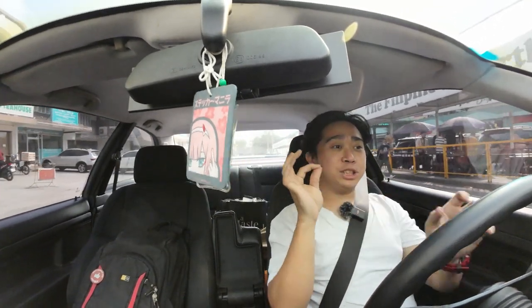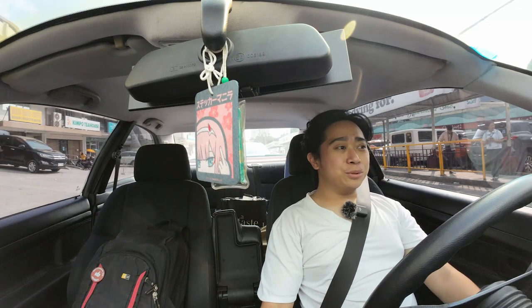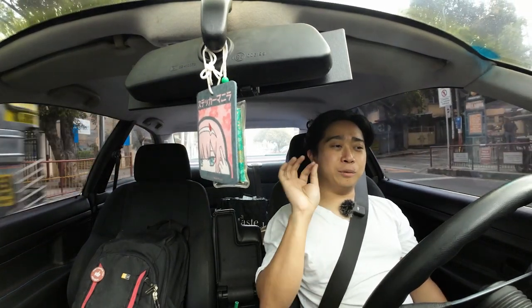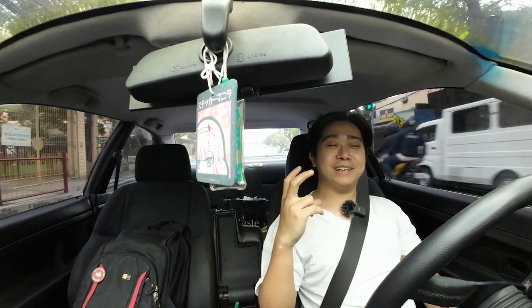Going back: with just the spring preload mod alone there's been a significant reduction in pedal effort. I tried it without the preload shim and the clutch felt lighter, and now with the preload shim it's even lighter. So from hurting my knee because the clutch was so stiff to being able to spend the whole day in traffic — very significant improvement. In summary: we installed the spring for a huge clutch improvement, then went one step further and installed one preload shim — a regular washer you can buy at a hardware store. I sort of want to add one more shim but since the mechanism is plastic I don't want to risk it.